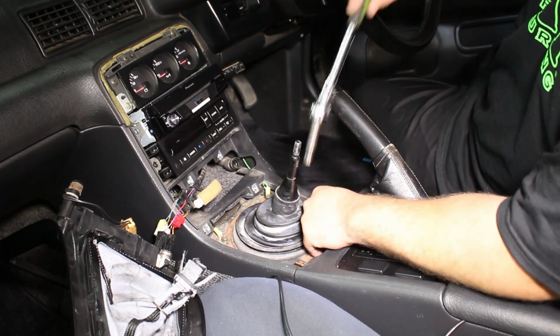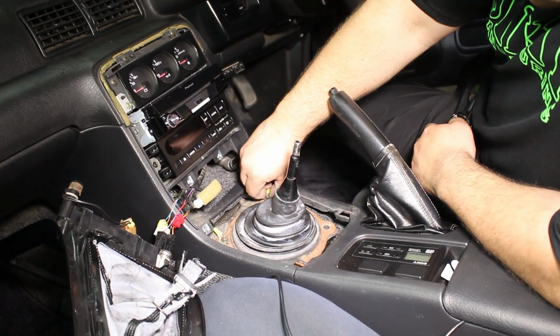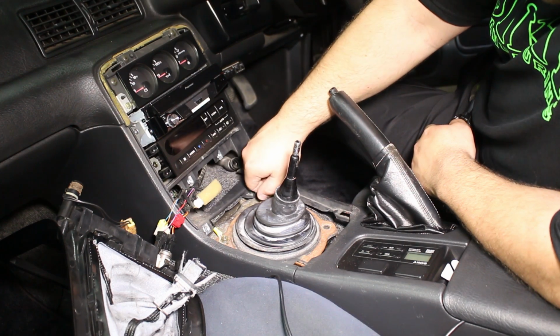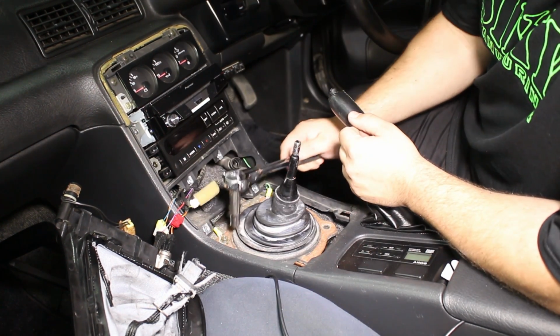So the car is running pretty good? Yeah, it's running right now. No boost leak? No, not since I replaced those messed up gaskets. Yeah. Both of the turbo hot pipe gaskets were blown. Jeez. So no freaking wonder, man.